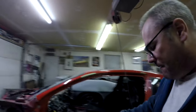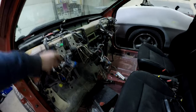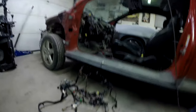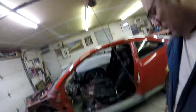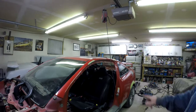I also realized that this wiring harness right here is for the dash and stereo. I also have to change it because the SS has a factory amplifier, so that's different too. I ended up pulling out all the harnesses to just change everything and be done with it. So we're going to pull these seats out and start laying this harness into the car.